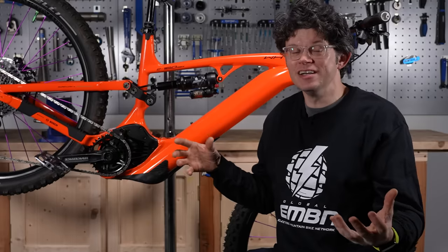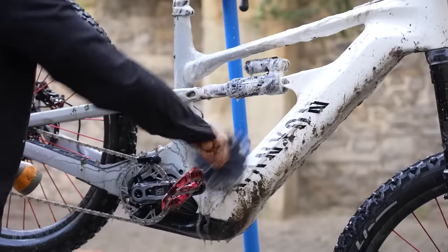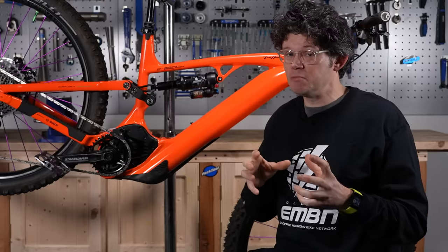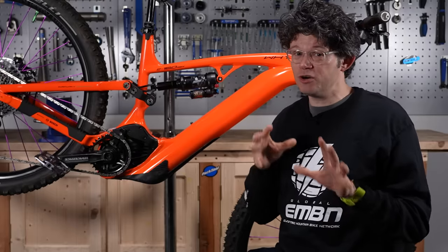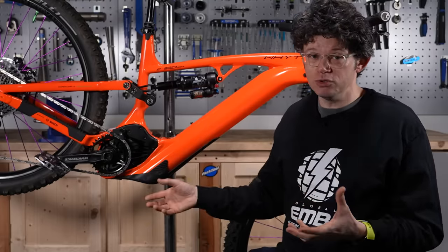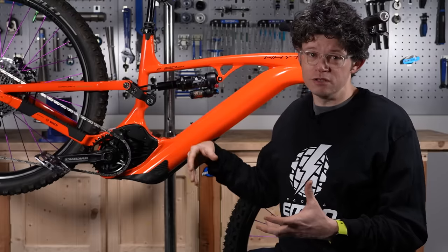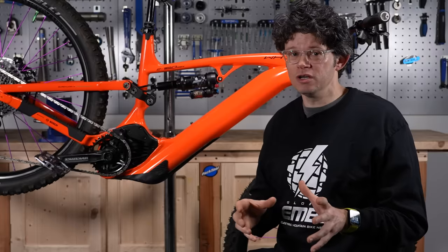After a wet and horrible ride, it's really tempting to quickly pressure wash your bike and blast all the mud off. Don't. Just take a little bit more time and wipe and brush that grit off. Pressure washers, even some of the low-pressure ones, can force water and grit into places that shouldn't have water. Most of the big brands' motor and battery combinations are really well sealed, but a pressure washer can really test those seals and it can get very expensive if you breach them. Bikes will often have drain ports around the bottom bracket, but if grit is forced into the frame voids by a pressure washer, that drain hole can be blocked.